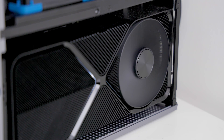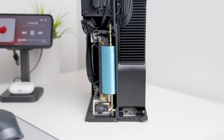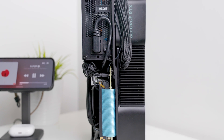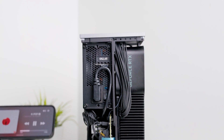I tried the upside-down configuration — the GPU was seated better, but the air bubbles in the CPU block made the noise unbearable. The 12-volt power connector sits slightly against the bottom panel, but the case closes with no problem. Purchasing a set of soft unsleeved cables from a mod DIY supplier is strongly recommended.